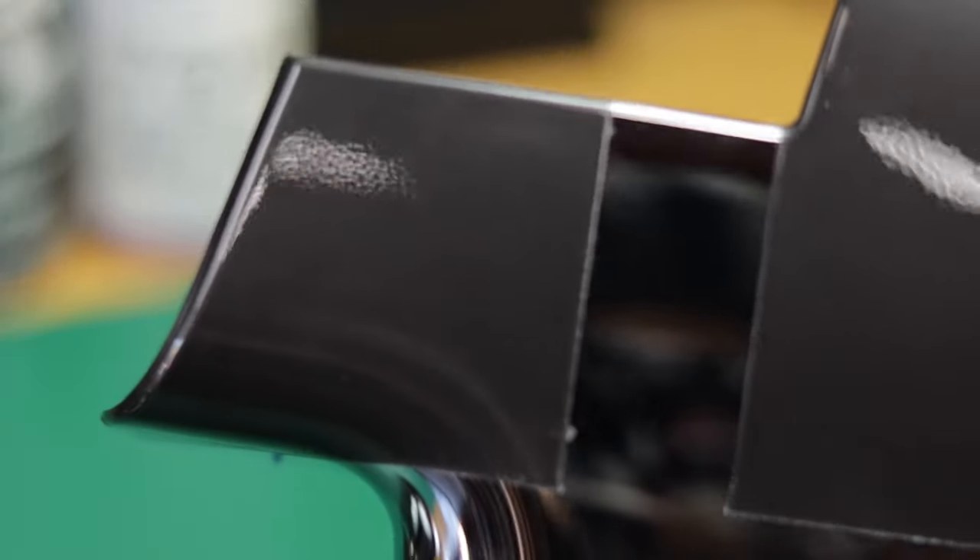All right, there you have it — Shadow Chrome is the winner again. The Rust-Oleum black color chrome was okay, just not the finish I was looking for, though maybe it works for other projects. I'm definitely not using adhesion promoter with Shadow Chrome anymore — it makes the surface less shiny. Hopefully 2k clear will help seal it in, though I doubt it if the base coat doesn't stick well, and I'll update you later. Be sure to like and subscribe and hit the bell to be notified when that update video comes out. Thanks for watching the Jet Fuel Only channel — I'll see you next time!